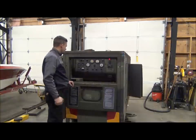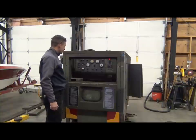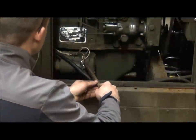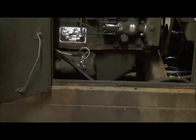We're not getting anything — not even hearing the solenoid click. There was a momentary crank, so we've got a little troubleshooting to do. We're going to test the solenoid operation by jumping from the positive terminal going to the solenoid to the start switch terminal to see if the engine actually cranks over. That appears to be working just fine — looks like the solenoid and starter motor are probably in good condition. We just have a loose connection somewhere else.